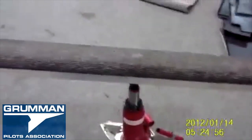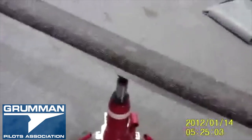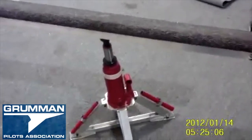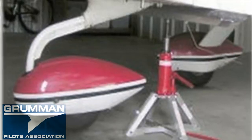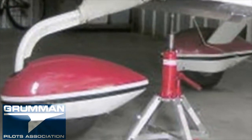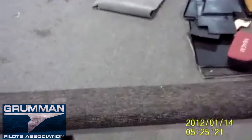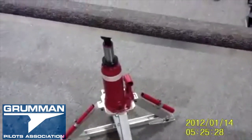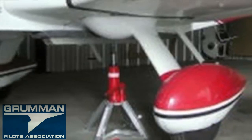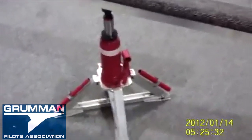What you have is a large surface area on which to push up on your honeycomb. On our airplanes, you don't put it just in the center — our honeycomb has real good strength on the bottom of the fuselage, four inches around the whole fuselage on the front and the two sides, not the rear. When we pick up the nose, we put this right in front of the bolts that come through for the torque tube. That way it can't slip out of position. We can jack it up and get the nose gear off the ground for anything we need to do, including removing the strut. We can also put it underneath the fuselage, centering it under the gear leg, along the fuselage to pick up one side of the aircraft at a time to remove the mains.